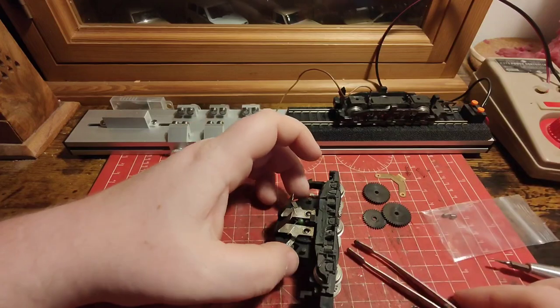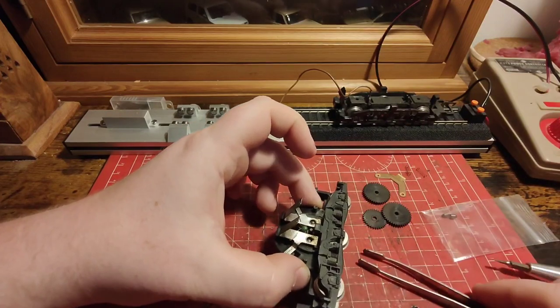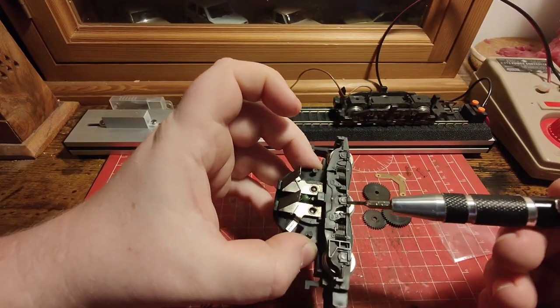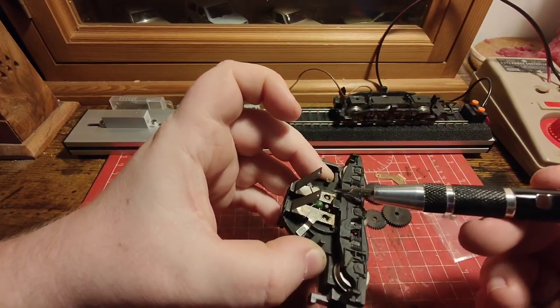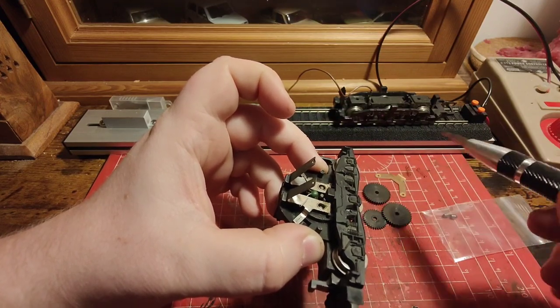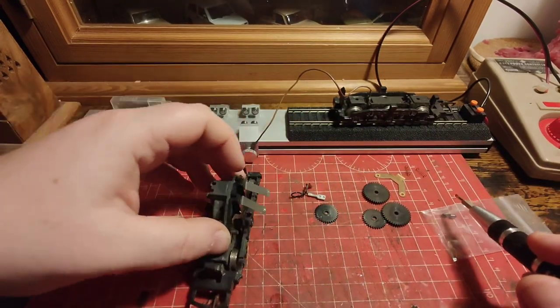It's almost jumped. There we go. Now, carbon brushes are in there. Looking at those — this one is sort of turtle heading, this one is a lot lower, so you'll probably find this is almost worn out and that one is almost not. So let's bang these out.